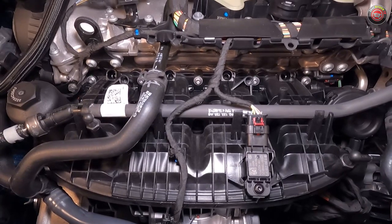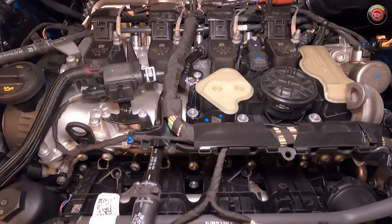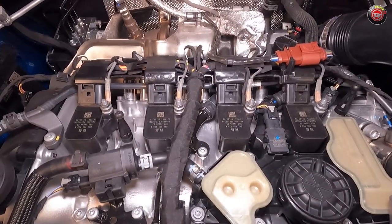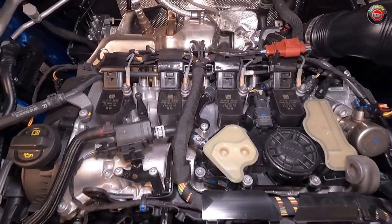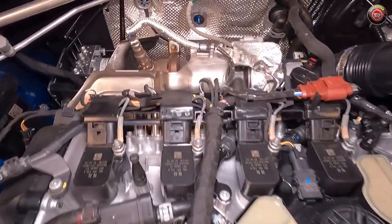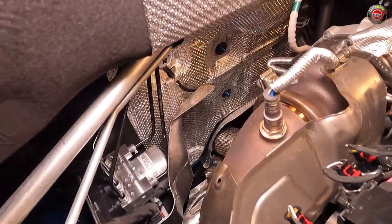Atop the engine, you can see all four of its spark plug coil packs and they're easily accessible. Much of the direct fuel injection system is hidden from view, but you can see the electric actuators for its variable exhaust valves at the top of the valve cover. Once the combustion process is complete, gases exit the cylinders through an exhaust manifold molded into the head and into the turbocharger at the rear.